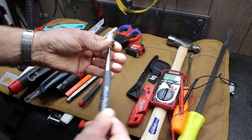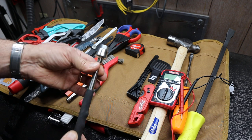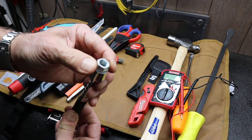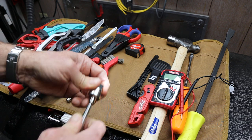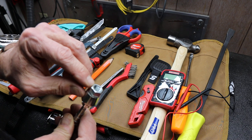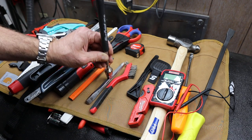Here's my Blue-Point universal pickup tool — basically a long magnetic shaft. Especially if you've got skid plates on your vehicles, there's really no way to get inside them if you drop something other than reach in with a magnetic pickup tool, or drive it up a hill and hope you can roll out whatever fell inside. Essential. Plus, this can actually be used to hold bolts or nuts — you can see I've got a nut on here so I can reach in and get it started, threaded. I leave a nut on it simply because it reduces the chance it's going to stick to something and yank out of my tool kit when I'm not looking.